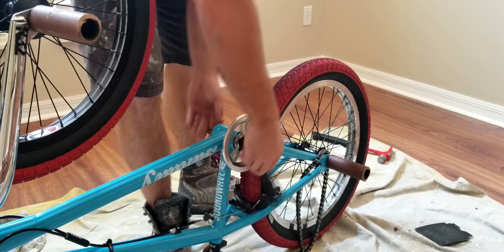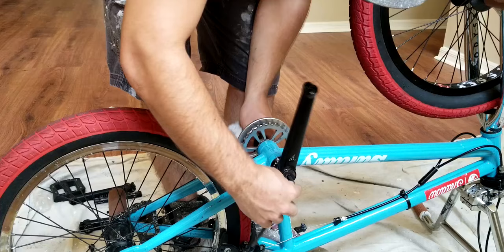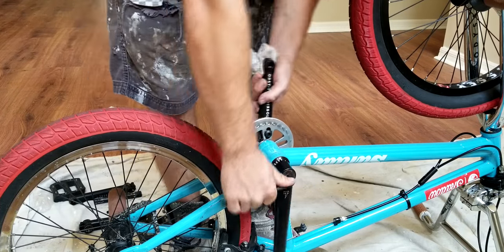Oh, yeah, and the nice thing is that they're two-piece cranks, and they just go together super easy. You saw the video, obviously, but the bottom brackets, that took me forever. When it came to the cranks, it was just put the sprocket bolt in, slide it through, put the other side on, tighten everything up, grease everything, and it was easy. It was super simple. Now if I ever have to take it apart, it'll be so easy. Just loosen that one side, take it apart, put it back together, tighten the one side. It's just simple. So I think that's another good reason that these are nice cranks.